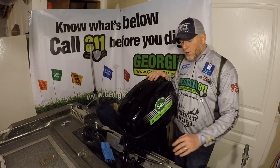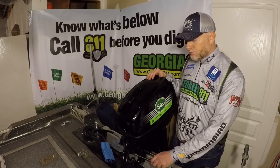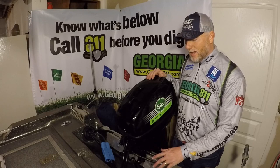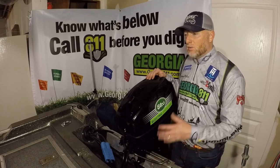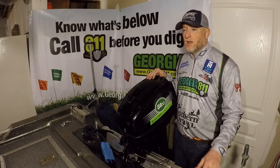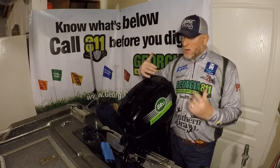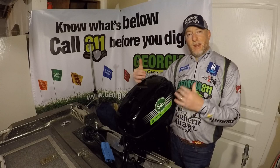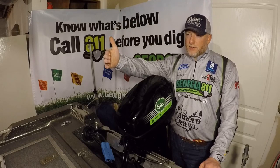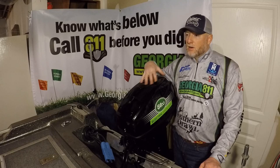We decided, me and my partner, Elco offers two different styles of motors. They offer a tiller style as well as a remote steer. The reason we decided to go with the remote steer instead of the tiller is the displacement of weight. Running a tiller, somebody would have to be in the back of the boat at all times. With the opportunity of displacement of battery and weight, going with a remote steer helps displace the weight